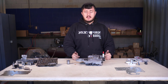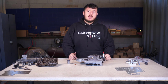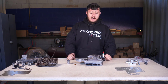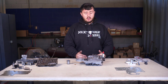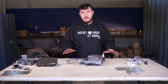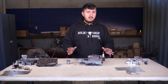For guys interested in high performance, an automatic valve body is an option — that's how most will come. But for guys interested in a full manual valve body setup, we take the 47 RE valve body and it mates directly into your 48 RE. The benefit is that in the 47 RE, the intermediate servo — second gear as a whole — is not solenoid controlled; it is a manual valve. This makes it much easier to build a manual valve body out of the 47. Whether you're looking for manual or automatic, ranging pressure or constant pressure, or whatever the desired configuration, we have it here.